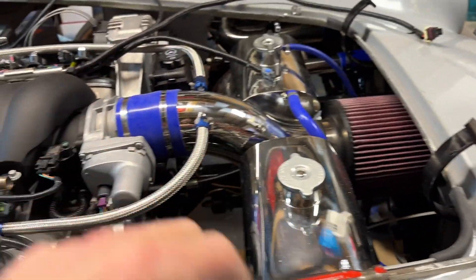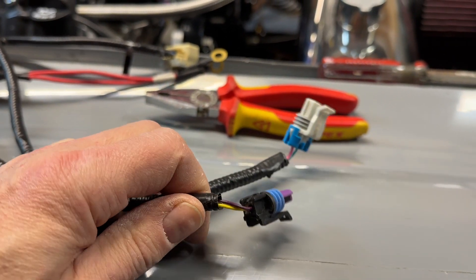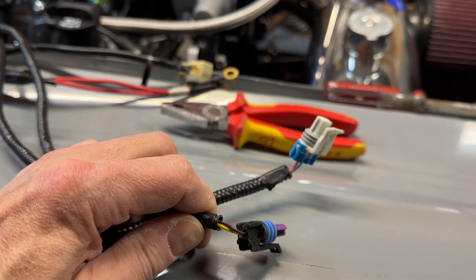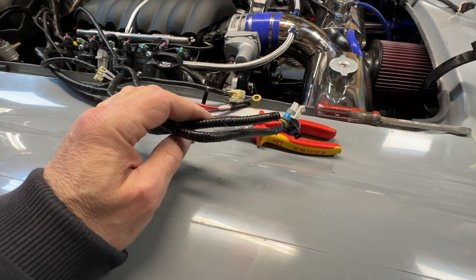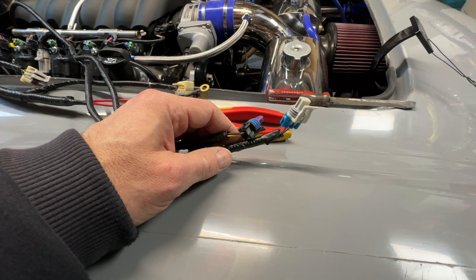The ones I'm a bit concerned about are marked 'gearbox.' I had a look at the instructions and I think they're pre-wired for the gearbox speed sensor and also the reverse — which I'm a bit miffed about, because we've just laid those cables and bought the plug specially, laid everything behind the dash. I may have to look at snipping these off and joining them up. Also, the reverse connector isn't even the right shape — it's a round one.